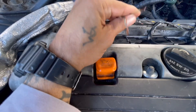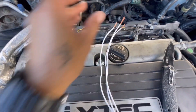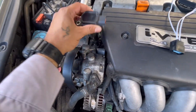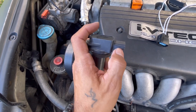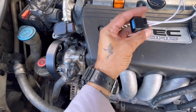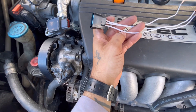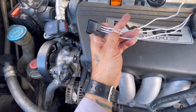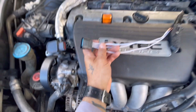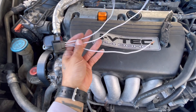I got them stripped and the new pigtail stripped as well. Remember the connector orientation — you can always test-fit it against the coil to confirm which direction the clip faces. The green-yellow wire goes in front, the black in the middle, and the black-white toward the back of the vehicle. I'm going to go ahead and wire this up.